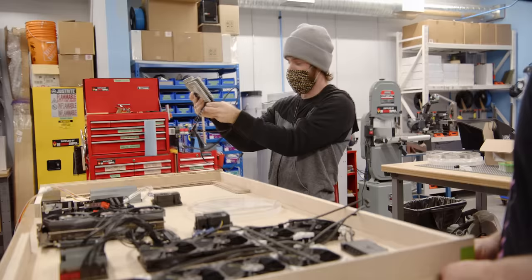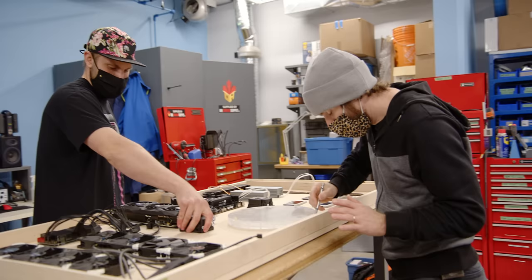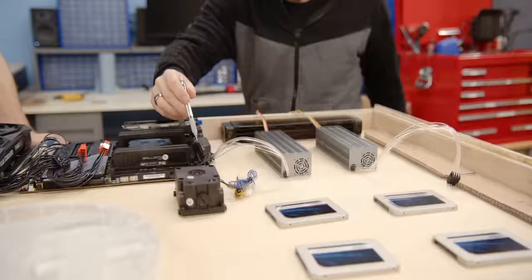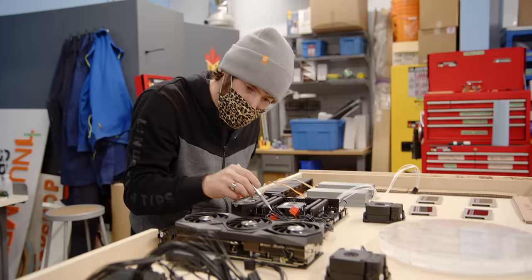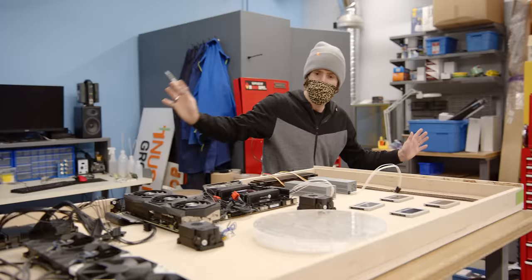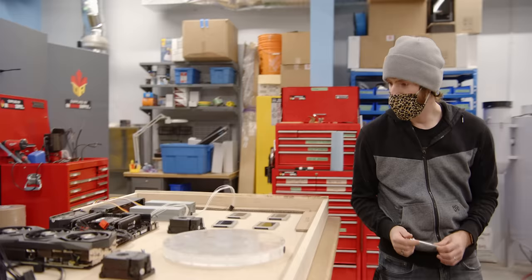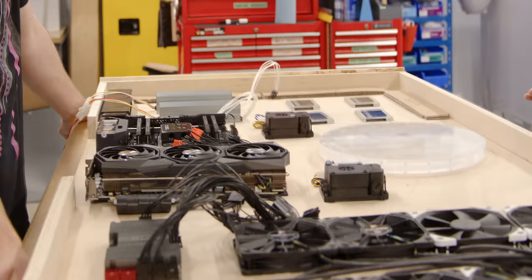So let's pull the cables off this for now. This might seem crazy, but we're going to be painting this for the finished product anyway, so drawing on it is not that stupid. Here's what I'm thinking: right angle here into the end cap, then we go straight out of here. We've got a height problem — we go this way and then into here. We go out from here into the graphics card, out of the graphics card, and then out into the reservoir. Very suboptimal from a filling perspective — it will take like an hour or two to fill. I was kind of hoping to put ports in the actual desk with a fill and drain area. We can use these vertical ports to put a fill funnel up here and just fill it. So we can fill the reservoir and flood the pumps so they don't run dry during the filling process. Teamwork makes the dream work.